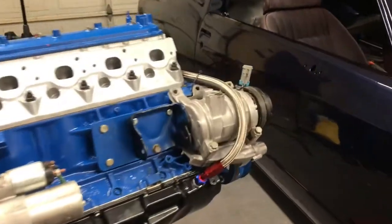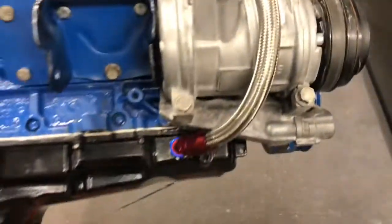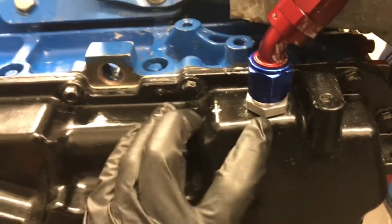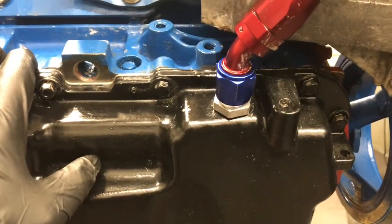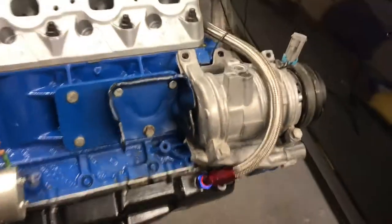All right, guys. So this here is the drain line that came with our GT45 eBay Turbo Kit. It's 24 inches, and that's the location right here with the 45 connector that it came with that I selected right here. And we're gonna run it straight to the top. Hopefully it falls out somewhere, maybe around here somewhere. But I had to go with the threaded connector. It's a 10 AN to an 8 AN fit, and I just had to tap and thread it. I'll be putting those videos up soon. So, yep, that's what it came with. I had to buy this here separate because the kit only comes with the bung that gives you the option to weld it on. So, I went with the threaded. I was actually going to go with it in this location, but we kind of tight up front. So, I think we should be fine right there. We'll see once we install this thing in the vehicle.